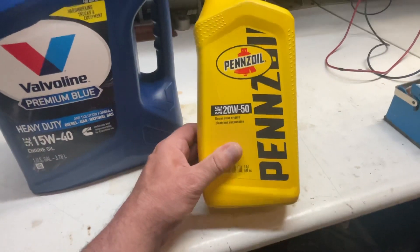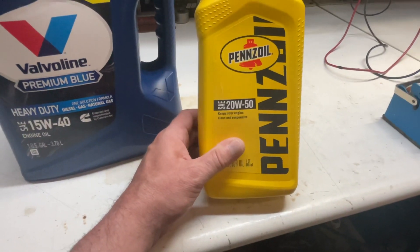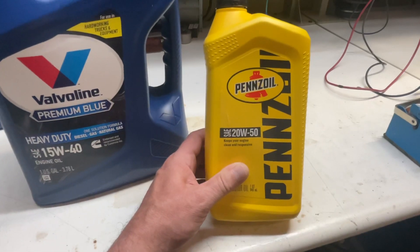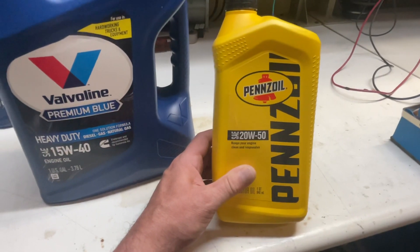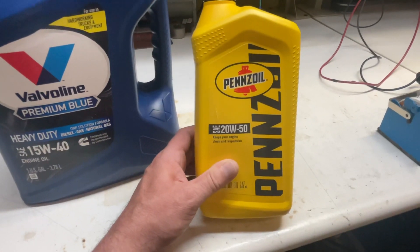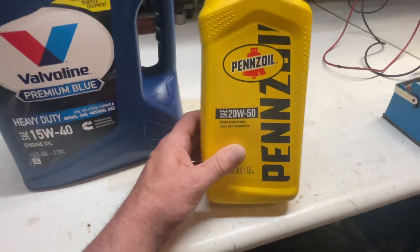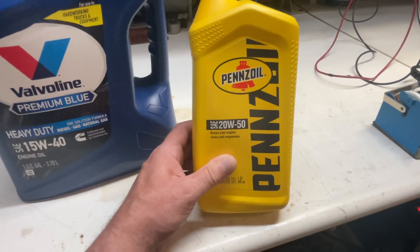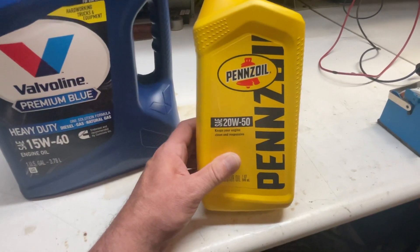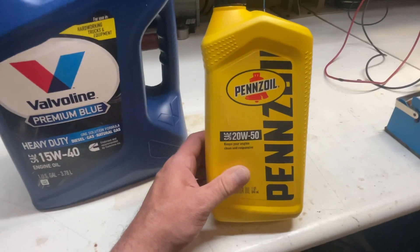With this being said, this is pretty heavy. If you saw my video about three or four months ago on my oil change, I showed you the startup procedure with this kind of heavy viscosity — how you prime the oil system before you actually get the car to start, because that takes about 20 seconds or better to build up oil pressure. I had this in my car from July of last year until this April, through the entire winter with no issues, no sounds coming from the camshafts or associated parts.